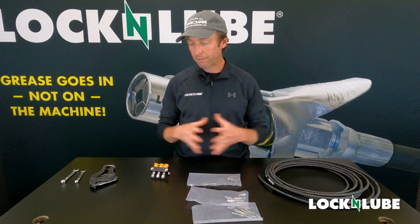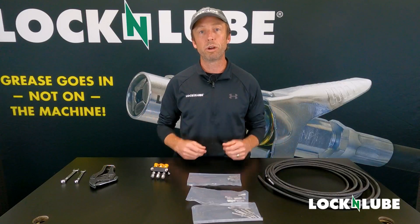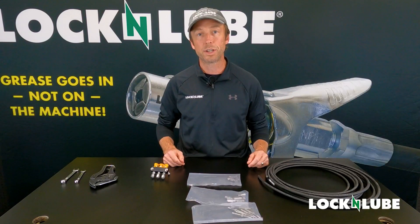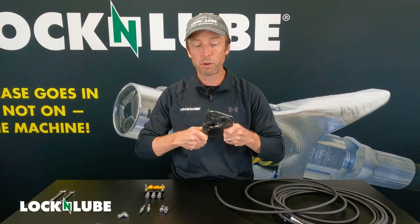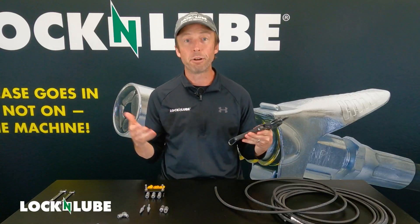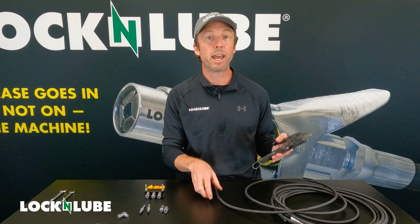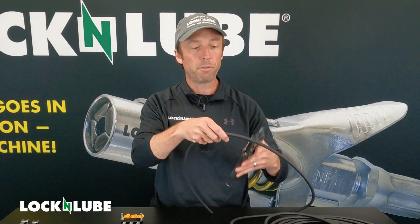That's the overview of what's included with the kit. Now we're going to get into what it looks like to set this up and get the hose cut and ready for installation. The first step is going to be cutting the hose to length. For our purposes, we're going to be using a pipe cutter — a PVC pipe cutter works really well. If you don't have one and you have a pocket knife or something, that will work; you just want to try to get a nice straight edge on it so that when you put the threaded tube on, it bottoms out evenly under the end of that hose. So we'll cut a couple feet here just for the purposes of this demonstration.